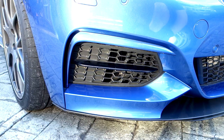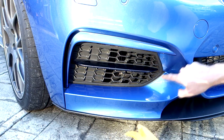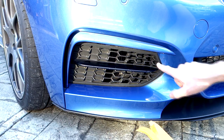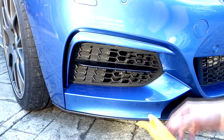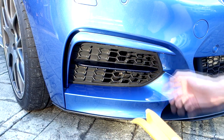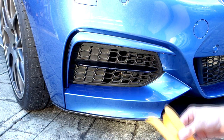The tools we're going to need for this are a bunch of plastic pry tools. You want pry tools that are a softer plastic than the paint and the areas of the front bumper. We're lucky here because the plastic that this grill is actually made out of is really, really nice and soft, so you don't have to be too worried about scratching the paint. It does require quite a bit of force to pop these out, but it's not overly dangerous — you've just got to be a little bit brave.